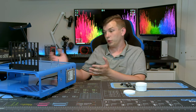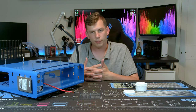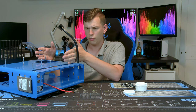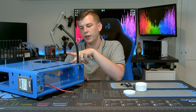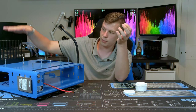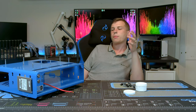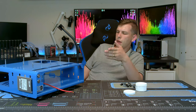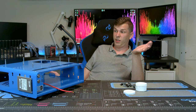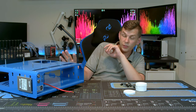Apart from that I had no major problems with it — it's great to use and it is exactly what you see. It's a test bench, so there's no cable management and I don't want there to be any, because I want to be able to add and remove cables from my modular power supply as and when I want. I want to be able to put a monstrous power supply in there with no space restrictions, fit a full ATX motherboard — you can even fit the extended ones past the last set of holes without any problems. There are no limitations in height, no limits to length of graphics cards. You could use it every day as your main system, but that's not really what it's designed for.